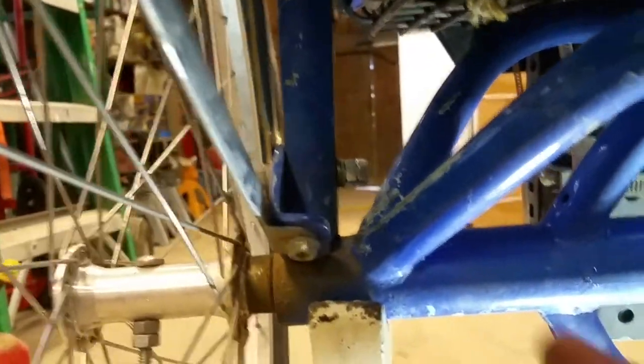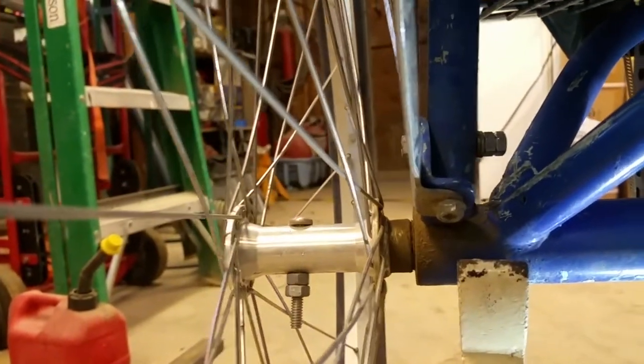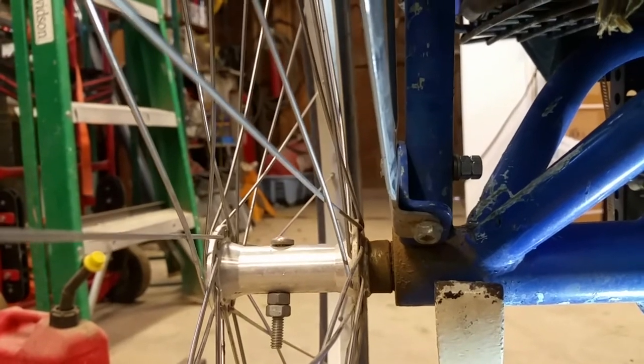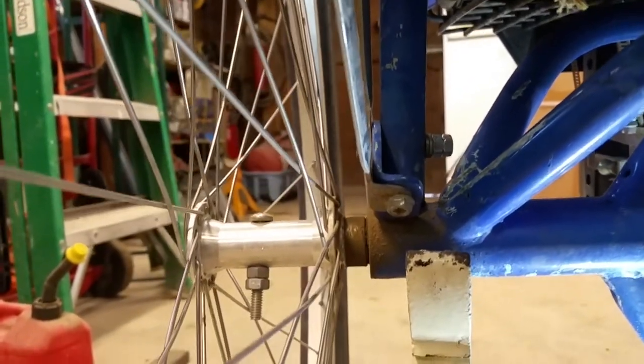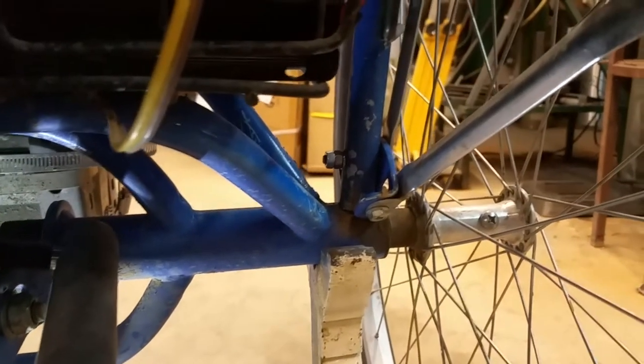Okay. Well, we caught a problem there. That bolt there, if you can see it there, had the nut come off, and the bolt had started backing out. If it would have got out any further, it could have got in under the spokes. So thank God we did this. And to prevent it happening to the other side, the port side, I mean, we went ahead and put another nut on it. Now then, we'll check out underneath the wells and everything.